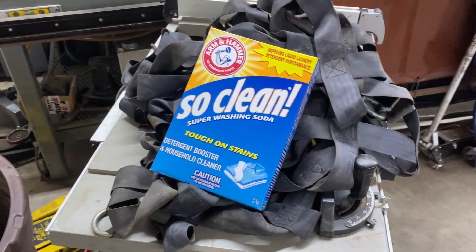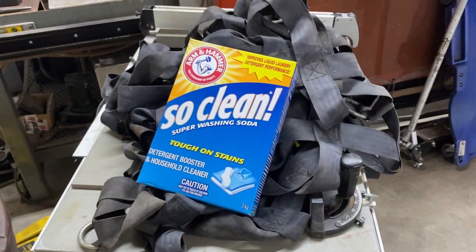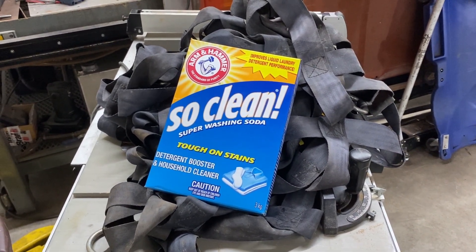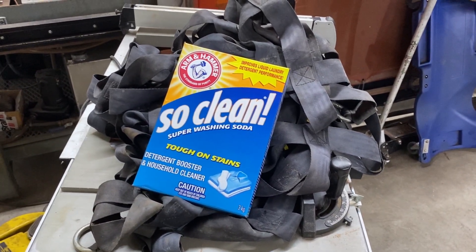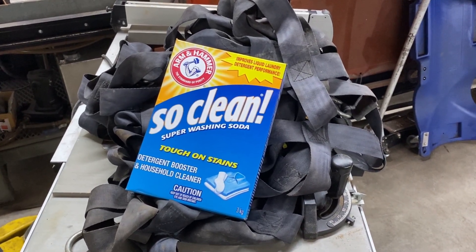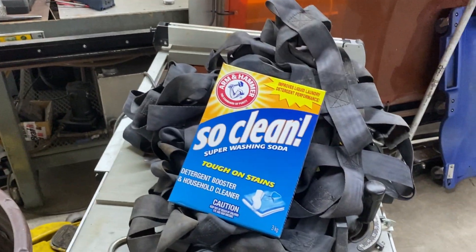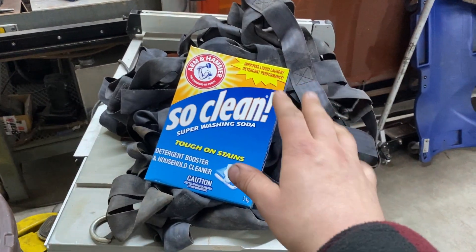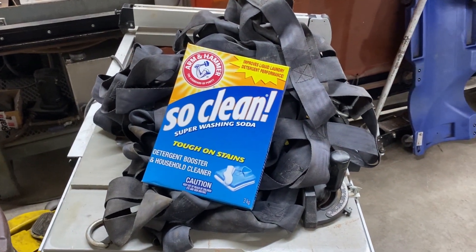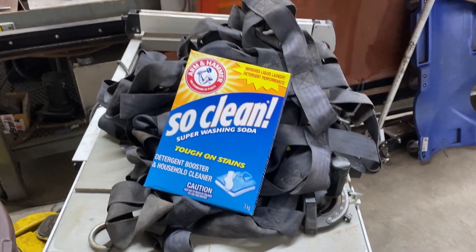After a quick run into town, I picked up some Arm & Hammer SoClean Super Washing Soda — this is just sodium carbonate. I got this because of an article on Successful Farming online about a tractor restore in Virginia that covers the whole electrolysis operation. I'll link that in the description if you want to read more. He recommended one-third of a cup per five gallons. I'm not going to have a full 55-gallon drum, so I'll probably do whatever 45 gallons would work out to. This acts as a medium so the water is conductive — there's some science behind it, but you can read the article for more.